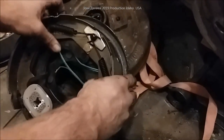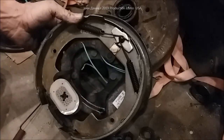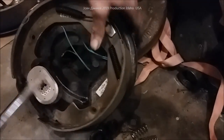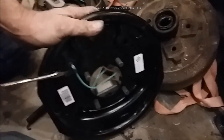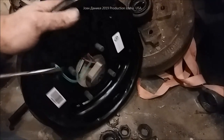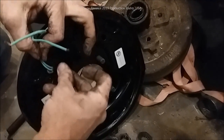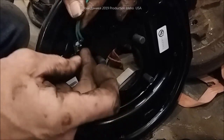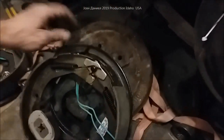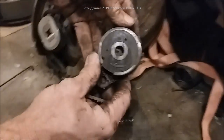I'll drop those off. I'm going to take this whole assembly, lift it up, and this will come off that shaft right there carefully with just a screwdriver — just walk it up a little bit. Before you do that, go ahead and pop your wiring off; there's just a little clip on these newer ones, and you'll work that out. It's a compression wire fit right here — just a little compression wire fit that'll pop off. Pull your wire out so you don't damage it. These wires are, I believe, 16 gauge. These are a little more efficient than the old ones — you can look at this old one here, how that thing was chewed up. There wasn't much left of it.